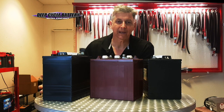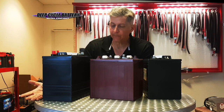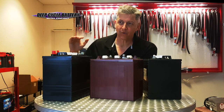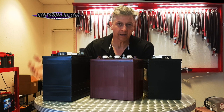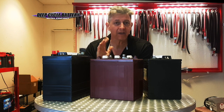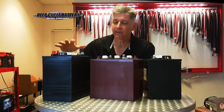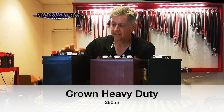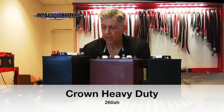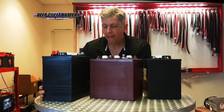If you have a commercial application — let's say you have a Taylor Dunn and you're dragging dumpsters — I've actually seen that. A flatbed Taylor Dunn was dragging dumpsters at a commercial site and the batteries we sold them would just fail very fast. You're going to need a heavier plate and a higher amp-hour battery, and that's what I love about the Crown Battery Company. This particular model is a 260 amp-hour, very robust, engineered, and robotically welded battery made in Ohio.